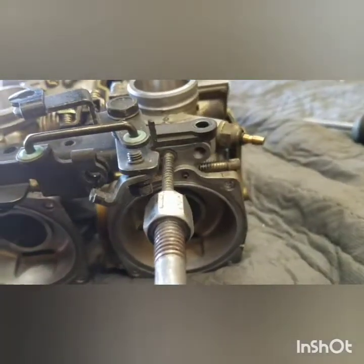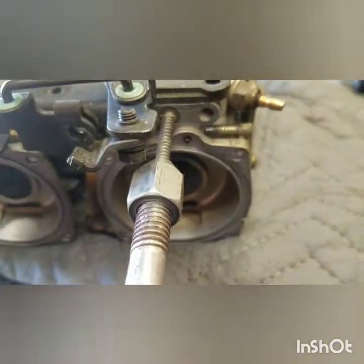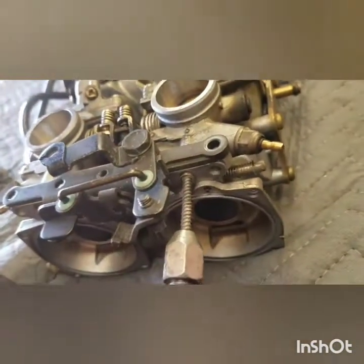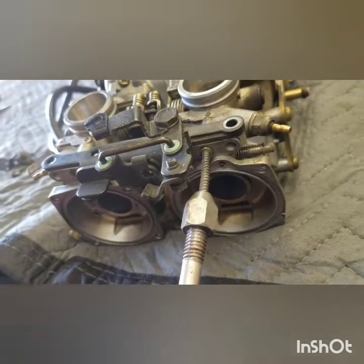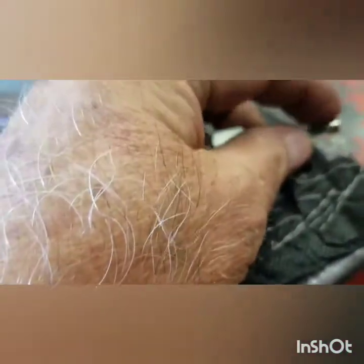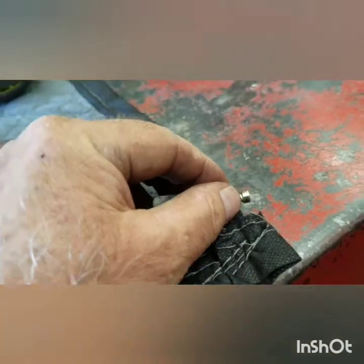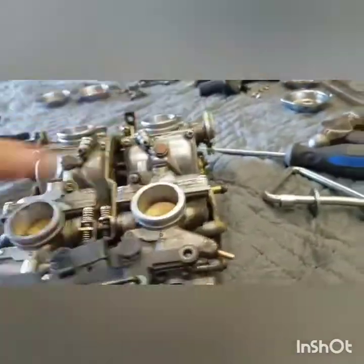You can see this one - as I said, just turning the screw in there and the whole plug is spinning. I'm going to put you down and just spin it to the right. As I'm tightening up my screw and pulling back on it, I'm spinning it to the right - I'm not using the hammer action at all, that's why you don't need a slide hammer. Spinning it to the right, pulling back to tighten the screw while I'm pulling back, and there it is. That's the plug. That's about an eighth of an inch thick, a little bit more. And there's your screw head down in it - those all need to come out.